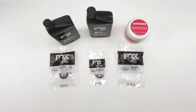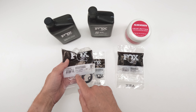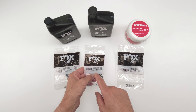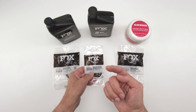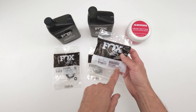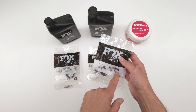Next up, let's go over the parts needed for the job. As for parts, we're going to need seal kits. Let's start off with the lowers — the 50 hour kit is 803-00945, but that is only for the 34. Make sure you grab the right seal kit for the right size fork. Air spring seal kit — 803-00-963, again for the 34. There are different versions, so make sure you get the right seal kit for your shock. The damper kit is 803-01-323, which is for a 32 and a 34 but only the Stepcast version — it won't work for the regular version.